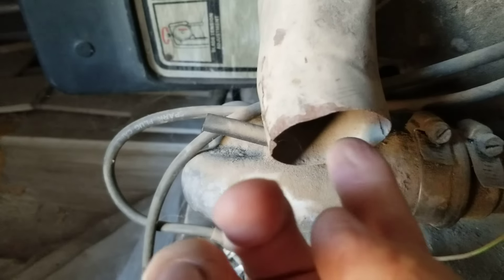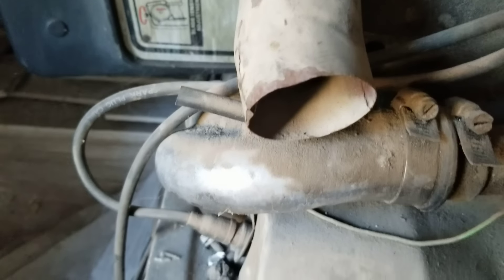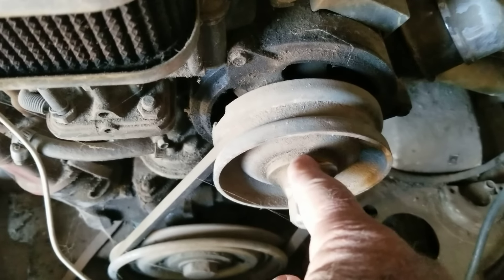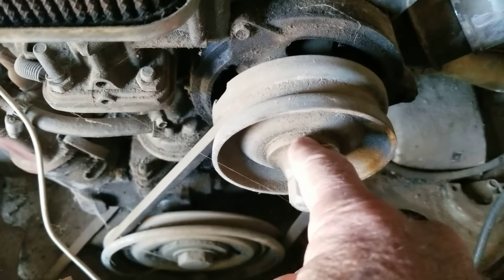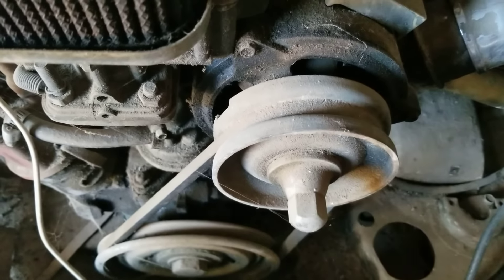Do not drive your car with the freeze plug holes open and no hose there. Also, do not put your pulley on without seven to nine shim washers. If you only use two or three thinking that's enough, that pulley is going to crack.